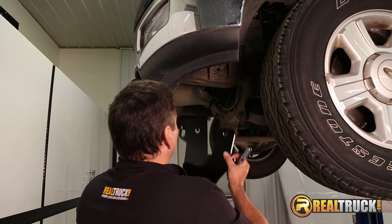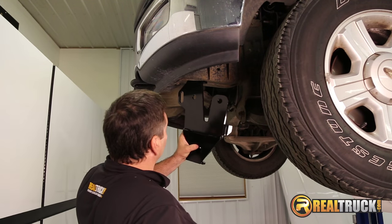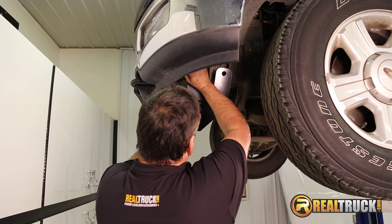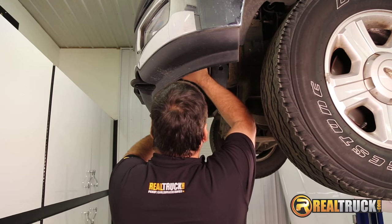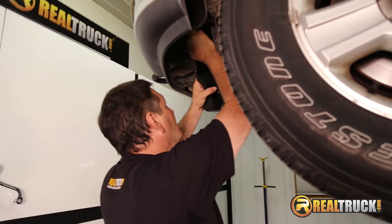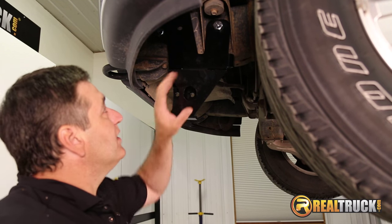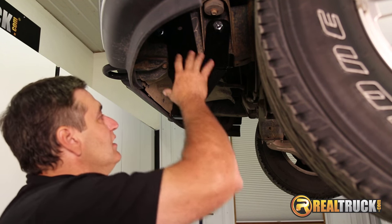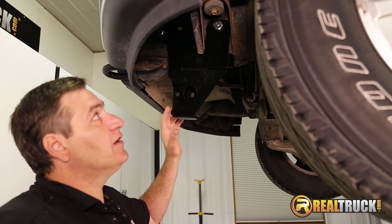So we're ready to start attaching our mounts. The first thing we're going to do is take our mount and one of the large bolts that come with the kit, and we're going to put our bolt through the slot here in our mount and put it into the front hole. The reason we want to do that first is because of the fog light pod on this truck — it won't let you get the bolt through there. Then we're going to grab the big washers and the big self-locking nuts to put on the other side, get them started, and leave this loose until we're ready to mount up our bar on this side.